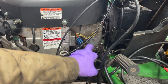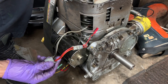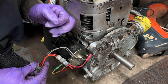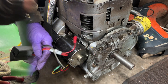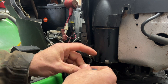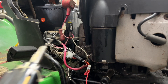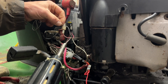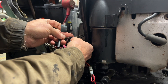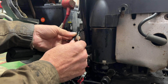I'm gonna hook up the John Deere wiring harness to this so it charges the battery. I took this wiring harness off a 19.5 horsepower motor - that motor is junk. This is the kill wire and this is the gray wire going to the carburetor. I'll put some heat shrink here, put some solder on, put a little piece of electrical tape there, and put the heat shrink on top right there.